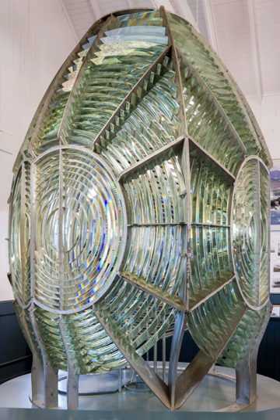Perhaps the most widespread use of Fresnel lenses, for a time, occurred in automobile headlamps, where they shape the roughly parallel beam from the parabolic reflector to meet requirements for dipped and main beam patterns — often both in the same headlamp unit, such as the European H4 design. For reasons of economy, weight, and impact resistance, newer cars have dispensed with glass Fresnel lenses, using multifaceted reflectors with plain polycarbonate lenses.